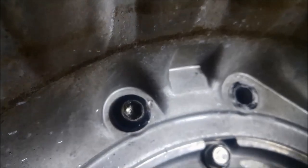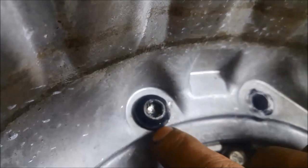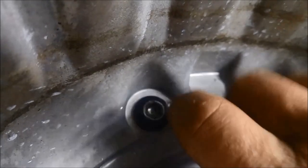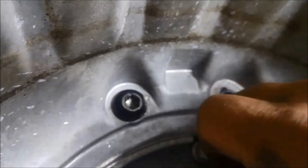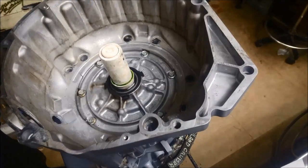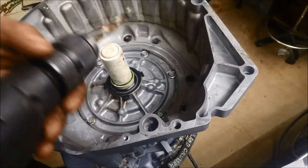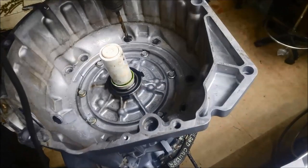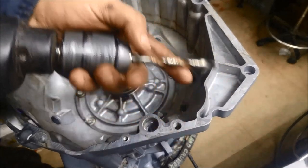So what I'm going to do is drill it out. If you use an 11/32 drill bit and drill down far enough, this head will just come off. And then I can take the whole bell housing off — there will be like a stud left inside in the case, and then I can just work that off. Use low speed on your drill — very high tensile, so you've got to go low speed and just slowly drill it out. I'll probably need to resharpen this drill a few times.